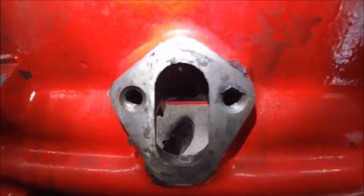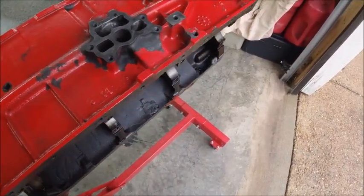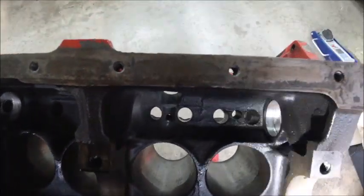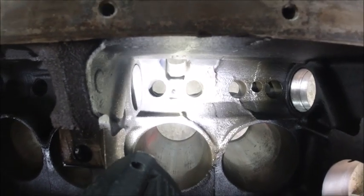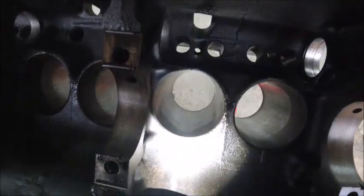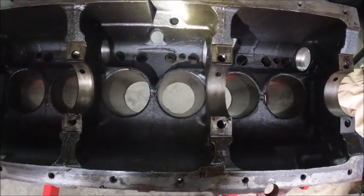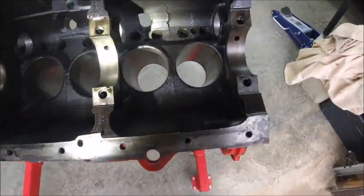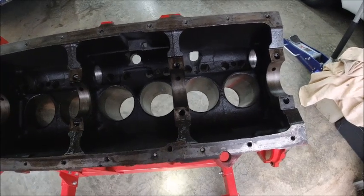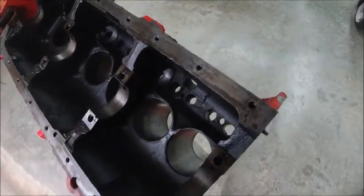Got rid of all the sharp corners, you can see how I smoothed all that out down in there. And here's the turny-turny turn, and underneath here I got that coming up right there — that's the hole that I drilled. I know that's going to hit the top side of the fuel pump, but a lot of it's going to flow back down onto it so it gets a little bit of splash. The rod right here is shooting oil so it's going to shoot oil there, but this will just help. So this is kind of it for this installment as far as grinding on the block. As far as putting the set screw in, I might change it up and put it in the head so I can show you guys different sizes and how much flow it allows. Anyway, this is it for this block.